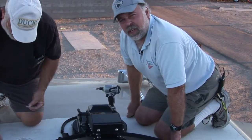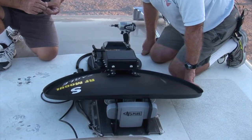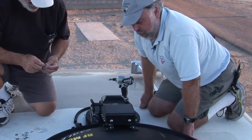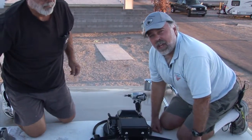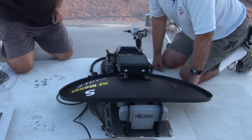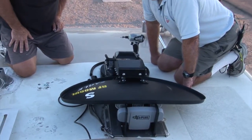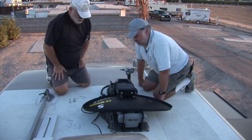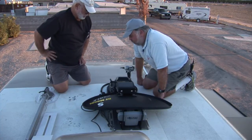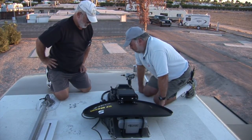The RF Mogul dish is up on the roof and the MotoSat dish is down on the ground. We're using the same base plate that the MotoSat unit used. We need to center the RF Mogul dish so that when it goes down it sits in the trough — there's plenty of space. We're going to use self-tapping screws in each of the four corners. One note: the RF Mogul dish does come with extension feet, but I took those off as recommended by RF Mogul — take the feet off, use the base plate by itself, and drill it down into the old MotoSat base plate.